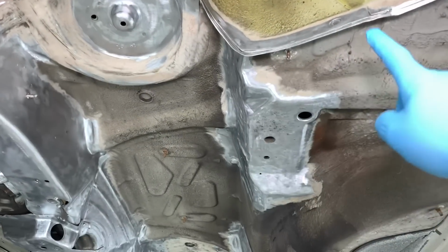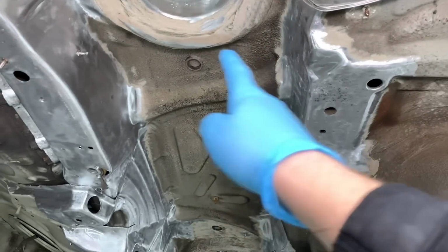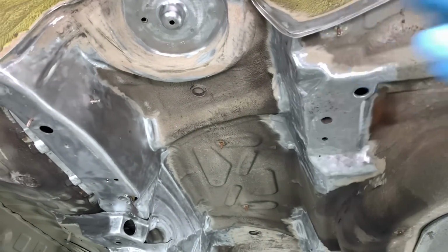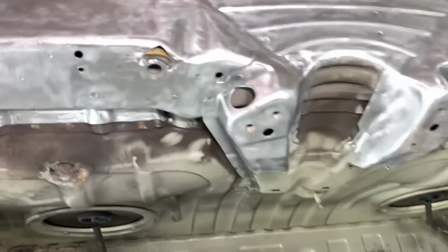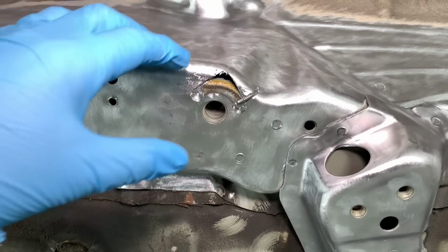And it's got other spot welds around the perimeter here and where it goes around the boot floor, and on the inner rectangle here where it overlaps the boot floor panel inside and chassis legs, but still 3 spot welds on there is pretty insignificant, so that's why we stitch weld that area as well. Front mounting points, again, we've just shown that it has got cracks. This is our first stage opening just to show that they've got cracks.